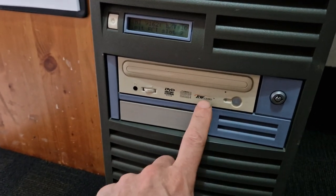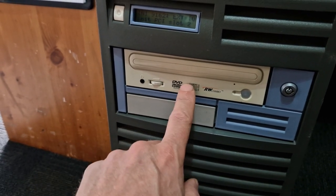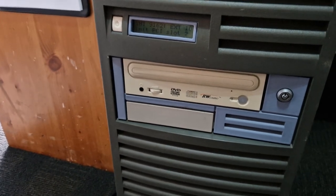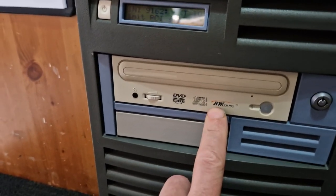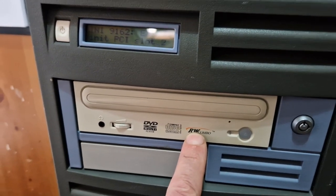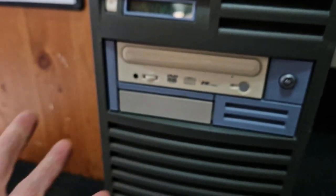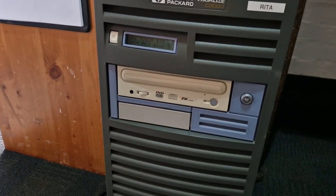That turned out to be on this type of unit, there's a drive belt from the motor to the mechanism. The first one had a pure gear mechanism, and the drive belts tend to deteriorate over time, and it wasn't giving enough torque. So I got a new one. If anybody cares, this Samsung unit, it was a 20 millimeter circumference square cross section with side 1.5 millimeters, and that did the trick. So that now ejects and loads quite well.